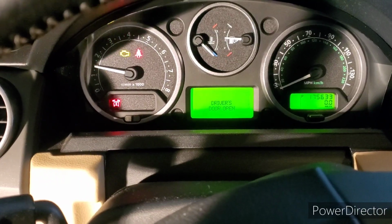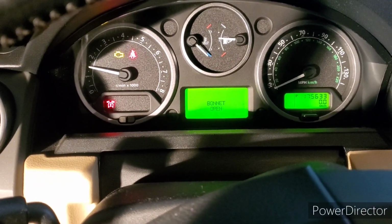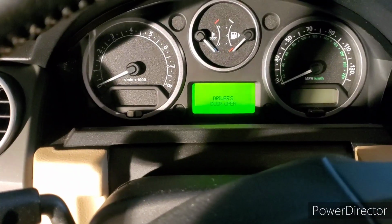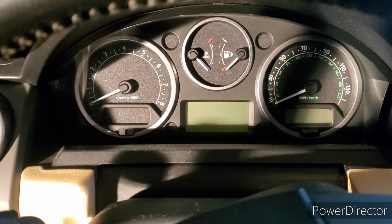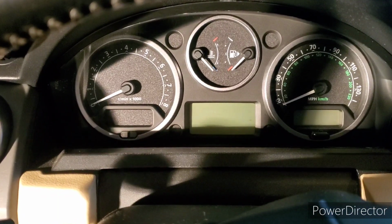So obviously there is some issue either with that EAS reflash unit. And we're gonna turn off. That is the second time trying it, and it started both times. So it is not a problem with the vehicle, the ECU, or any of its systems, not the immobilizer.